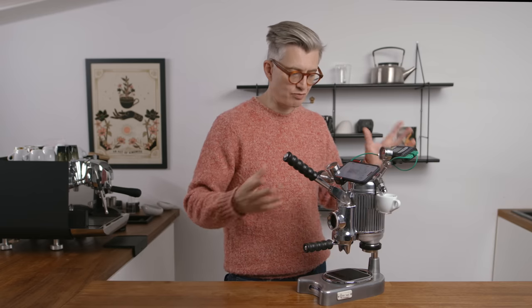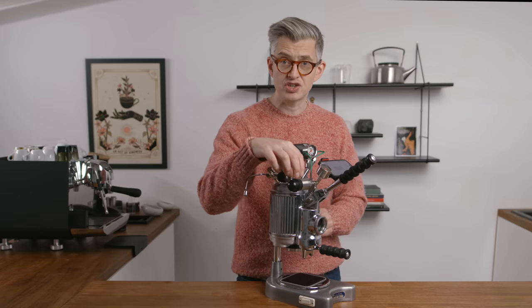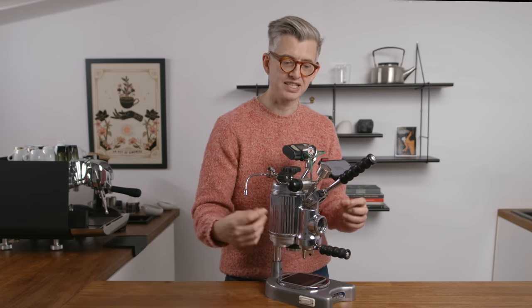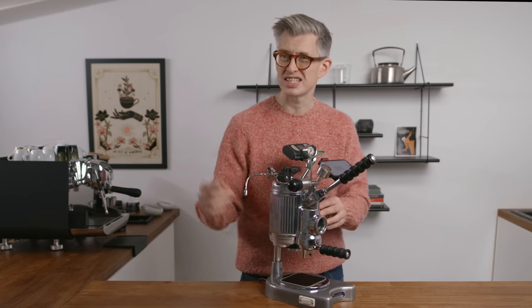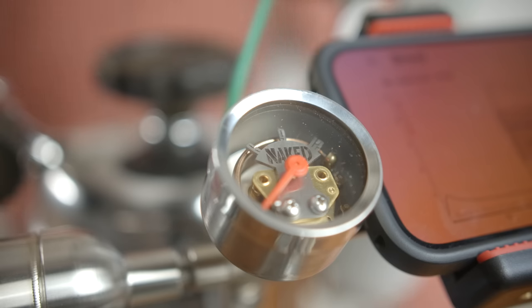Let me talk you through what's been done to this espresso machine, apart from being descaled, cleaned up, re-chromed, made to look pretty again. If you're familiar with the Smart Espresso Profiler, it is a digital pressure transducer. Here it can read the pressures inside the group as the shot is pulling. This is a spring-driven lever machine, so you press a spring to build pressure and release the spring to drive water through the coffee. There's also a little pressure gauge just for the classic analog experience.